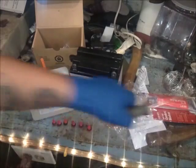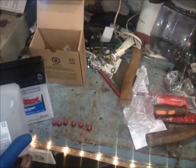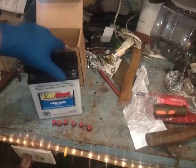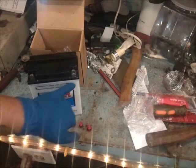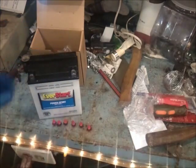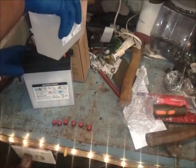Now comes the fun part. My workbench just happens to be dirty and obviously I work better that way. If you notice real quick before I flip it around — this lower line is simply marked lower level, the top one would be marked upper level. It even has it on the front of the case — plus and minus so it's easy to identify, and as well on top of your battery: negative, positive. I'm going to insert that — try not to spill acid, and as soon as I put it in there I did spill some acid. This is why I say precaution.